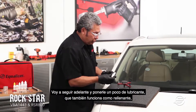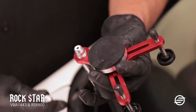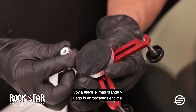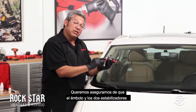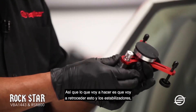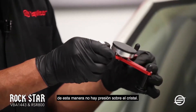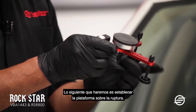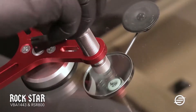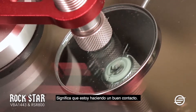I'm going to put a little lubricant, which is the pit filler, so this way the O-ring sits on there. This is when we determine which O-ring we're going to use. I'm going to choose the larger one and screw that on top. We want to make sure that the actual plunger and the two outrigger legs are below the vacuum cup, so I'm going to back this off. I'm starting to see the O-ring get a little greener, and that's a good sign — it means I'm making good contact.